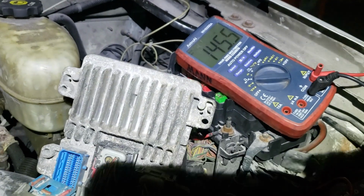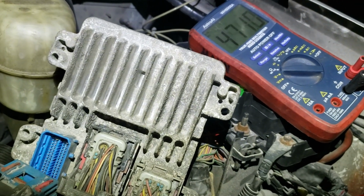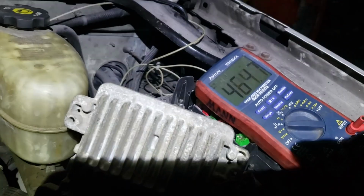I had them up and inspected, and didn't see any problems with the wiring. But as you see here, I had all kinds of ohm readings changing. Now, I didn't catch it on camera, but I had up to 500 ohms when I was wiggling the wires. I couldn't figure out where. I peeled back the harness a little bit, but what I found out is it's right at the connector. Right smack dab at that connector is where this issue is. So next trip, I'm going to bypass that connector for the high-speed CAN bus. That's the yellow and the green wire.